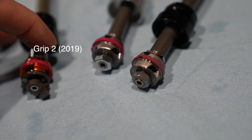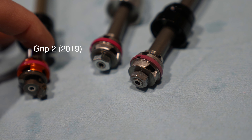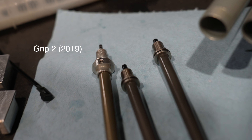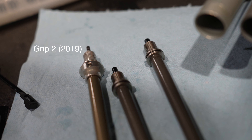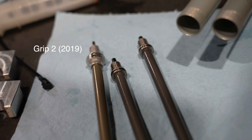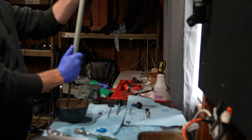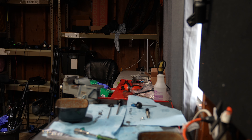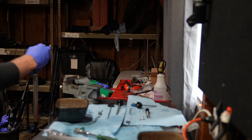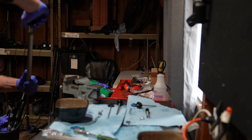While making this video I was doing a little research, and did you know you could put a grip 2 compression assembly in a normal grip damper? Basically you can buy this spring-backed IFP compression needle and the knob, and you just have one rebound adjuster on the bottom. But they're perpetually sold out, so don't even think about doing it. The grip 2 compression assembly only costs a hundred bucks if you were able to find one.